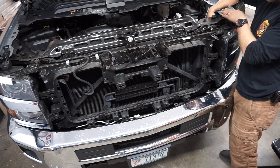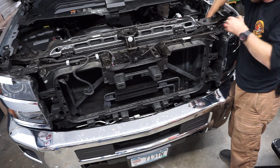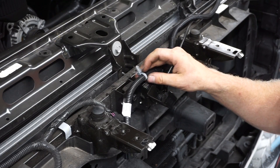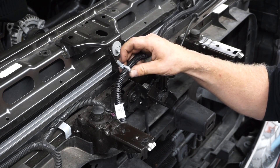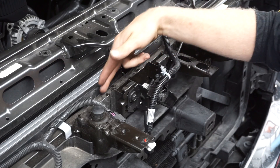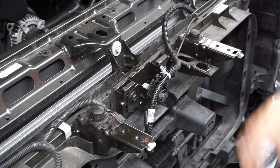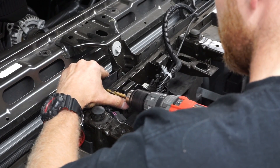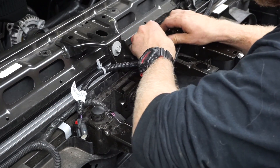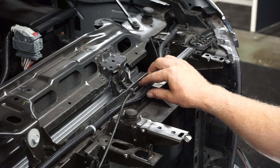I want to come up on top of the headlight and follow the hood release cable lever. I've seen people run them down below, but I don't want to see that cable or zip ties. The factory sends OEM clips with the kit, so I'm going to drill a little hole through this plastic housing and utilize it to maintain the wire harness in place. Being near the hood latch, I'll run the wire harness right along here, drill a hole to use the two clips on the harness, and zip tie the rest to the hood latch release cable.